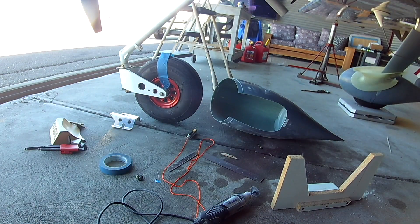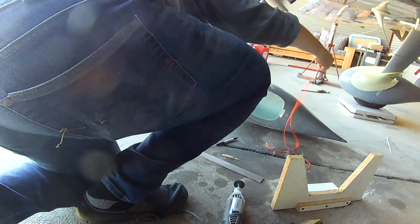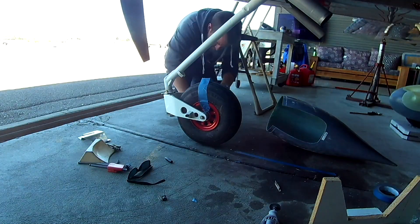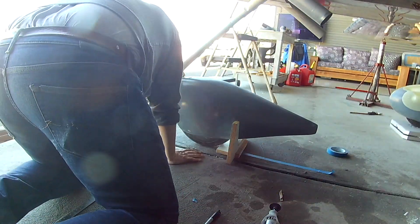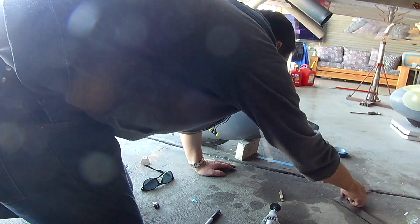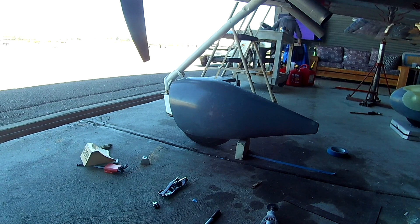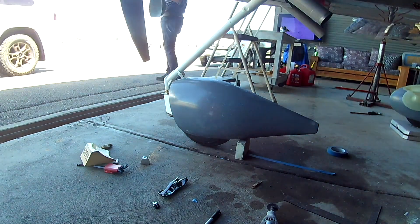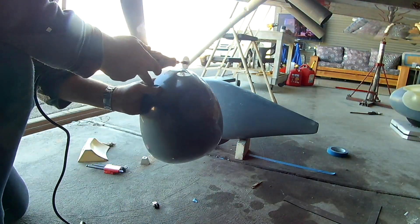The second challenge is that off both sides of the front wheel there's going to be a brace which connects the front wheel fork with the fairing. The problem is you can't have both of those on and put the fairing on at the same time. So you have one bracket mounted, slip the fairing on, then reach your hand in and sort of position the other bracket in place on the other side of the fairing. It's a giant pain in the butt.